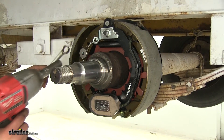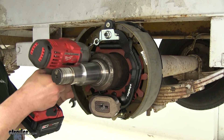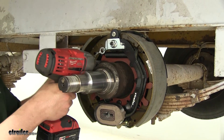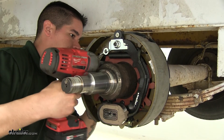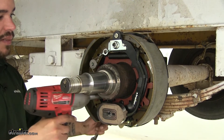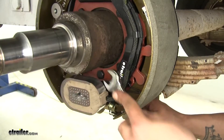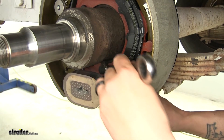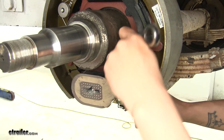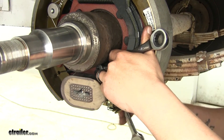With our wire connections made, we can come back and tighten up our seven bolts holding our assembly onto the axle. I'm going to be using a 5/8 socket to hold the head of the bolt and an 11/16 wrench to hold the nut on the back side. I'm just going to go around and snug them all up before I tighten them all the way. For the one that's behind the magnet, you're going to want to take a 5/8 wrench and sneak it in underneath the spindle to get a hold of it, then use a ratchet wrench or socket to snug up the nut on the back side.